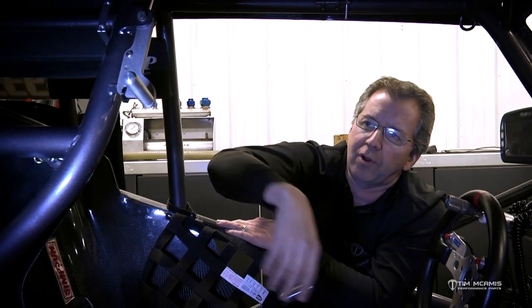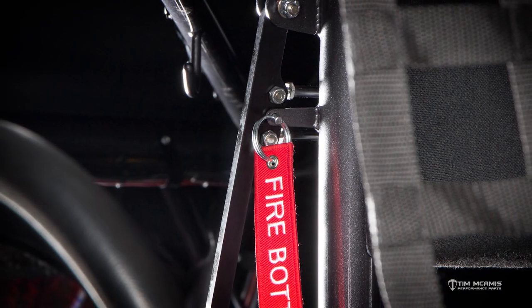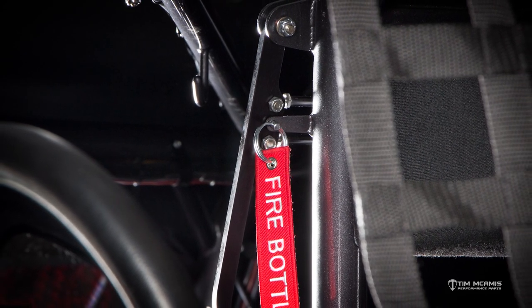We put a little tab on all these cars so that you can put a pin in there, so while you're servicing the transmission or working inside the car, you don't accidentally set the fire bottles off. Apparently the new trend is to take the pin out and put a zip tie in there so it permanently doesn't move. All good — unless you're on fire. Now you're on fire, you're upside down, you're against the guardrail, the cockpit's full of smoke. You finally reach over to grab the fire bottle handle, but you've zip tied it so it doesn't move. Maybe you have enough adrenaline because your ass is on fire doing 200 miles an hour to break that zip tie — but maybe not. Those things are pretty strong; this one's zip tied tight.